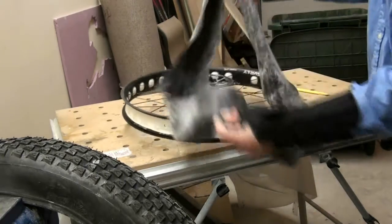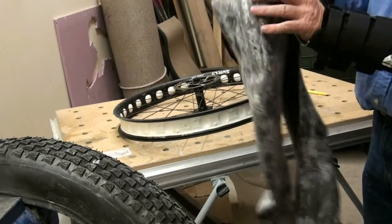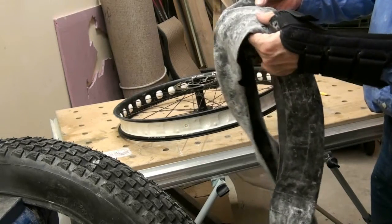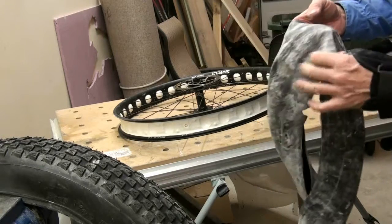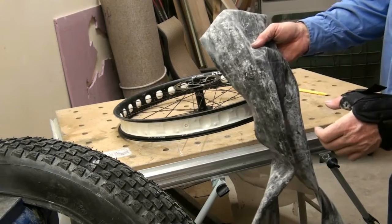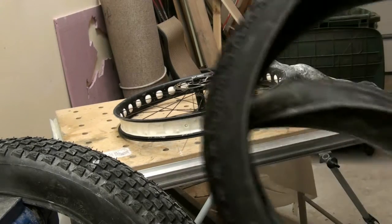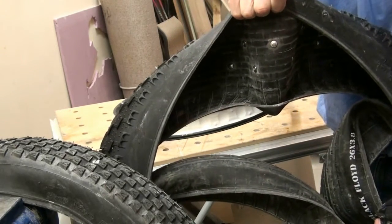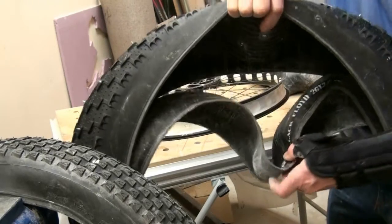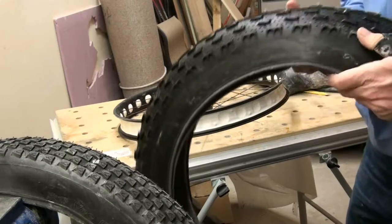We split a tube here — the tube goes on the inside. If those set screws go through it, they've only got another sixteenth of an inch to travel, so this helps protect the tire. On my other wheel I left another tire on there — it's a little heavy because of the screws. You can pull it out underneath and see the screw heads. Without this extra tire, those screw heads would wear out the inner tube in about an hour. Using just a split tube like this has lasted a good three months.